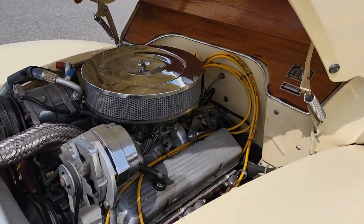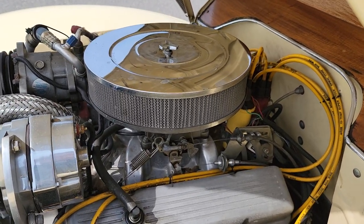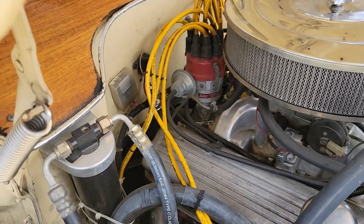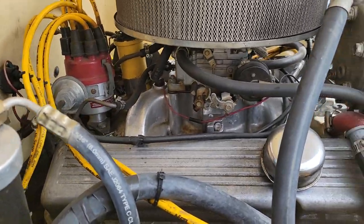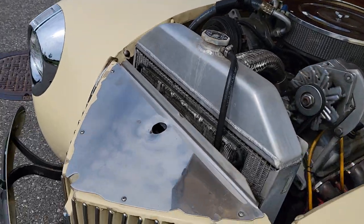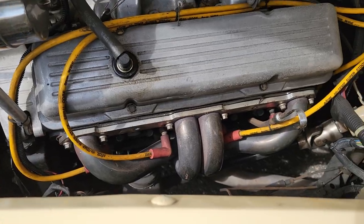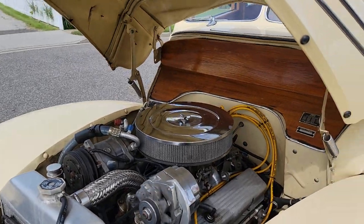350, very mild setup. Electronic ignition, shorty headers, Lumina manifolds, Mallory distributor. It's like a 600 carburetor with electric choke. Custom aluminum radiator, custom aluminum shroud. Looks like a flex fan. Underneath you've got independent suspension with a rack and pinion setup — I guess like a '70, '72 Camaro or something like that. Pretty cool.